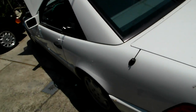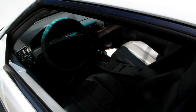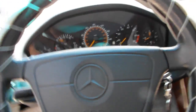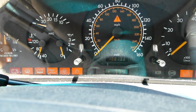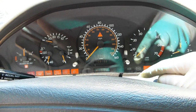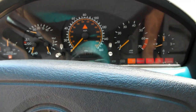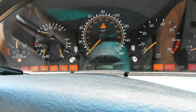This video basically covers S-Class, E-Class vehicles with V8 motors. First of all, we're going to show what the car is doing. It's in beautiful condition and only has 108,000 miles. A very unprofessional repair was done on it where somebody just removed the bulbs for ABS and ASR, so as you can see if I turn on the ignition, they just don't light up at all.